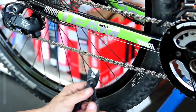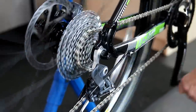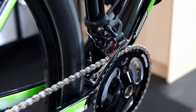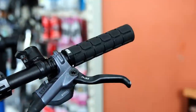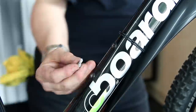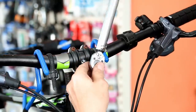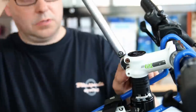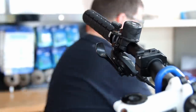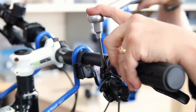A new chain went on here. I probably could have cleaned the rust off the old one, but it was very seized on a couple of links and I don't think it would have been successful to continue using — the rust was too ingrained, and I think it would have worn very quickly or snapped. So a new chain was good practice here. The customer also asked me to swap the grips for new ones. A little bit of anti-seize grease on the threads for the bottle cage, and then we work through the bike with the torque wrench — the last phase — including lining up and tightening the bell.